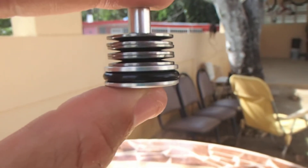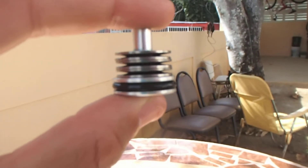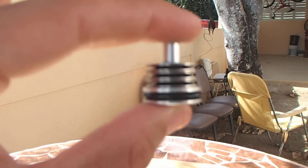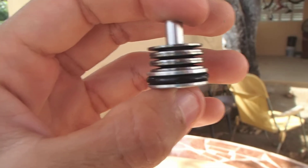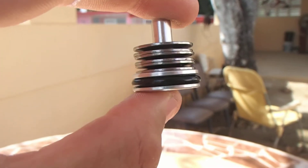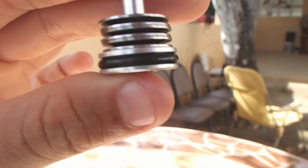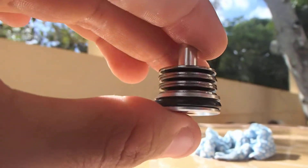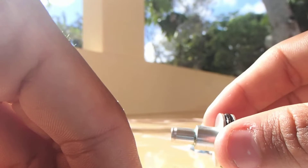You can see that the first one on the piston is flat, the other one is curved face down, and the other one is curved. It goes flat, curved face down, flat side, curved face down. Look at it closely — it goes just like that. You can see we have an o-ring on the bottom. Let's maintain it. Since I showed you guys how the shim stack goes, let's maintain the piston.